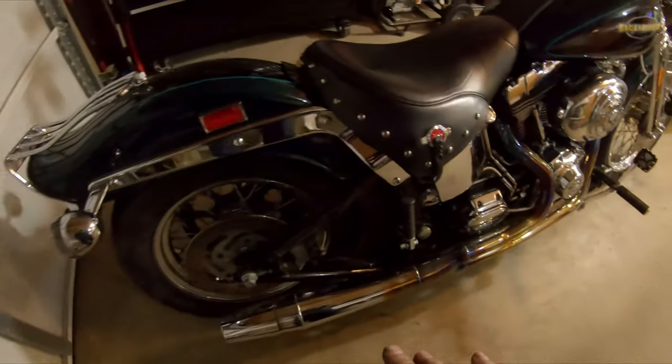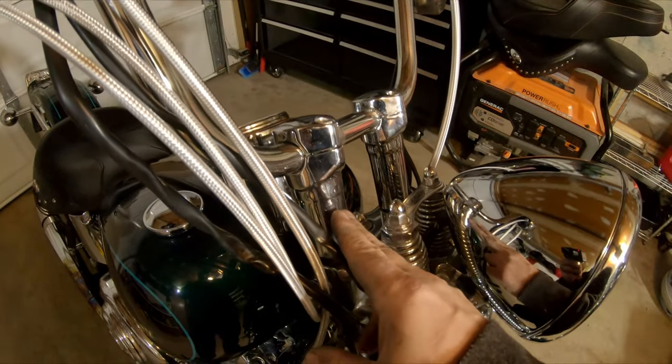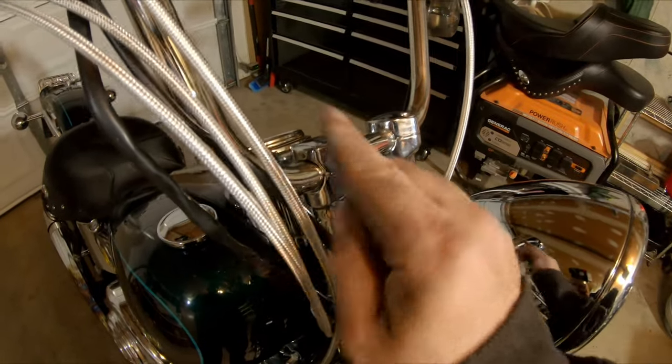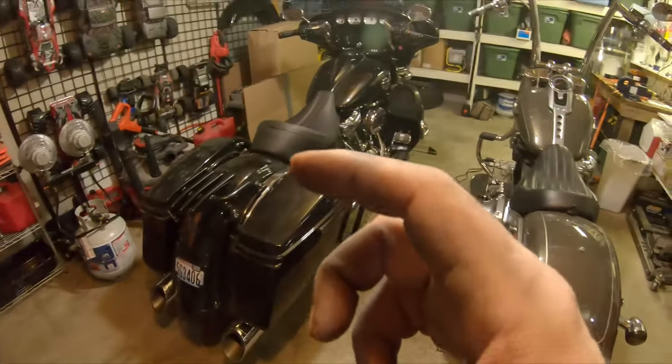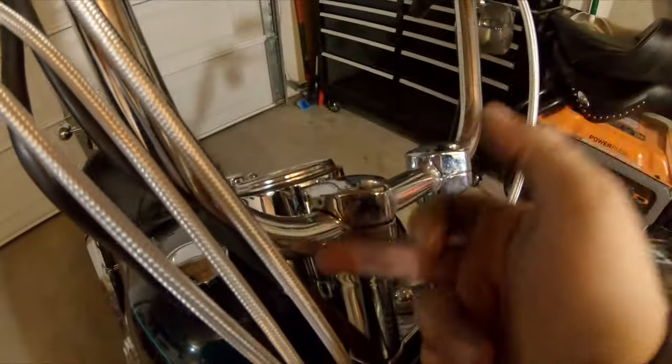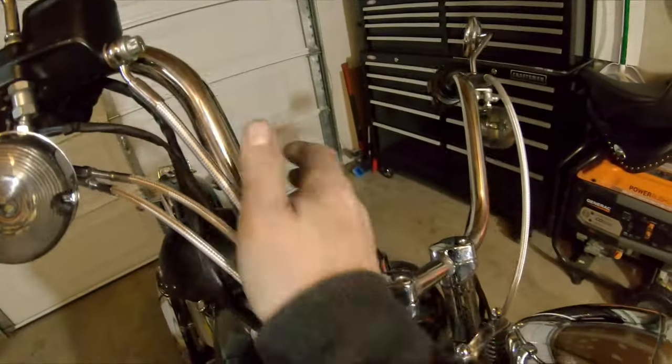Got the bars back on, got the helicoils in the risers and torqued those down to about 170 inch-pounds — I can go up to 180, but I decided let's give it a whirl at 170. What I did was use what I know as plumber's tape — it's about an inch wide, you can get it in 25- or 10-foot spools and it's got a bunch of holes punched in it, like hanger tape. I just wrapped it around the bar once until it met but did not overlap, put the cap on top, and torqued it. These bars ain't going nowhere like they did before.